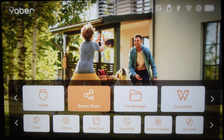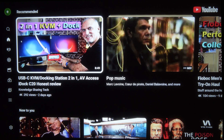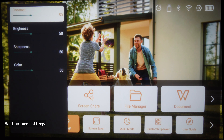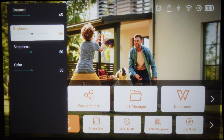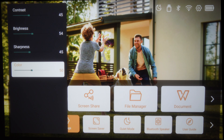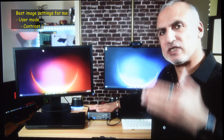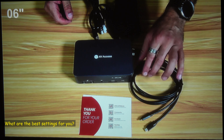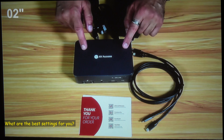I've turned on my TV box and connected it via HDMI. Let me start YouTube and play a high-resolution 4K video. The picture quality as-is is a little dark, so I'm going to put it in user mode, reduce the contrast, increase the brightness slightly, reduce the sharpness a bit, and add a little more color. The result is way better than before — it's not dark anymore and not pixelating. Leave a comment below if you find a setting you prefer.